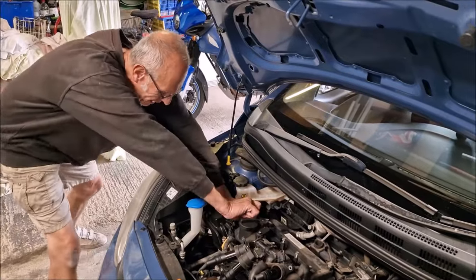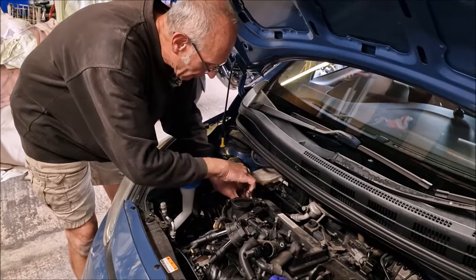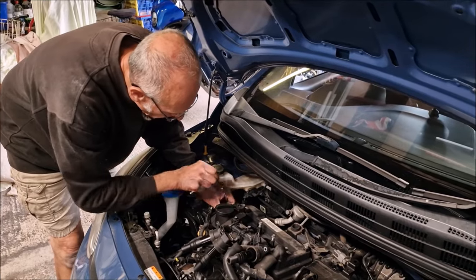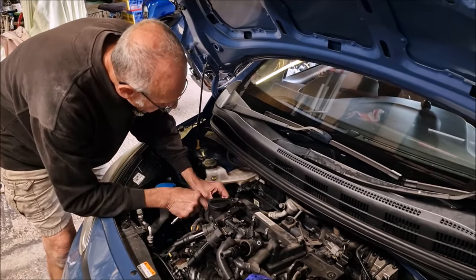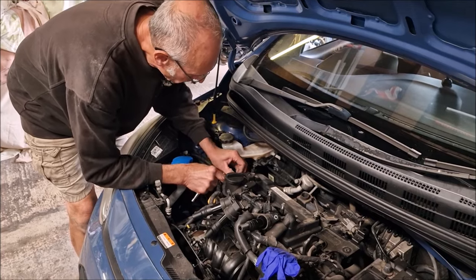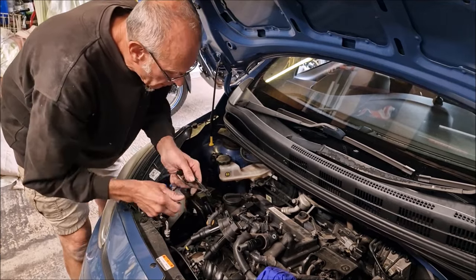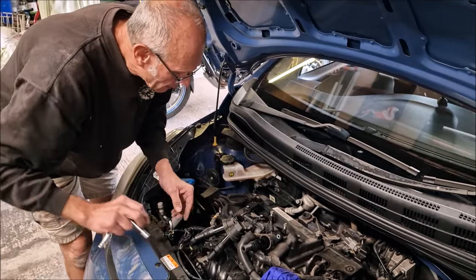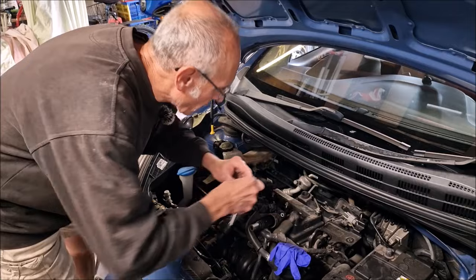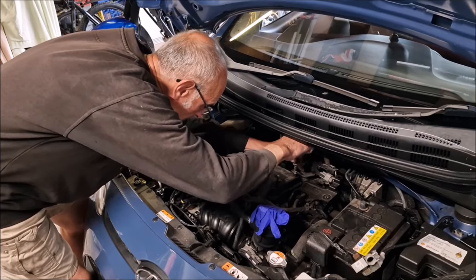And why would an oil change neglect damage that timing chain? Modern timing chains are a bit quaint about oil changes. We don't know the history of the car. We haven't got a major service history with it. It's been through main dealers most of its life, but that doesn't mean anything nowadays, sadly. And I understand from what I've looked at on forums, there is a known fault with funny little noises from Hyundai 1 litre timing chains. It's the same thing with a Kia. It's not detrimental to the vehicle, but whatever it's doing is definitely getting worse.